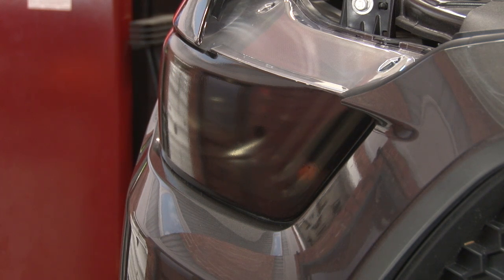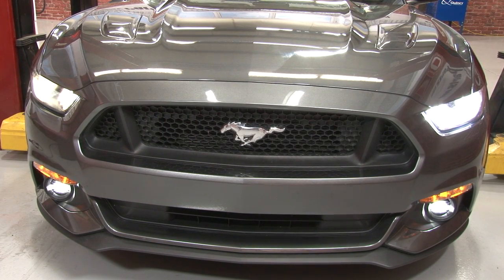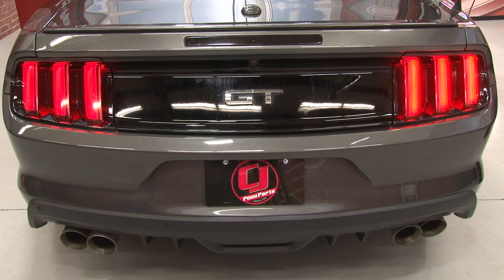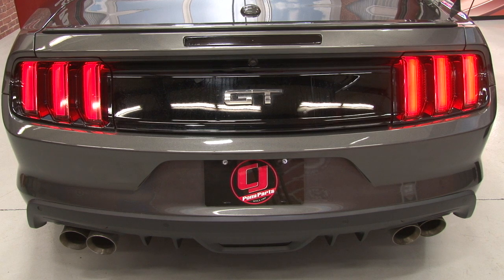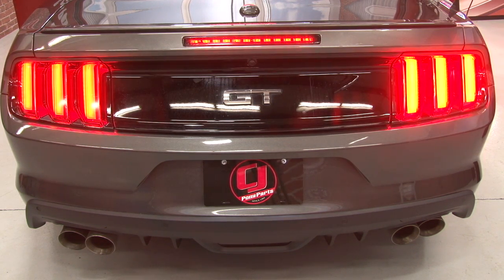Now repeat the process on the other side and your installation is finished. I'm sure a lot of you watching are worried about light output with the tinted lights. As you can see, the fog lights and marker lights make almost no difference at all. The headlights, you will lose a little bit of output, but the factory headlights are so bright they're still plenty acceptable. Same thing goes for the tail lights — our driver's side is tinted and our passenger side isn't. The LED tail lights are so bright on the 2015 through 2016 Mustang you'll barely notice the tint when they're on. You'll still see plenty bright, both parking lights and brake lights.